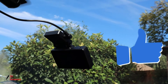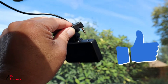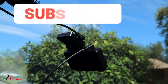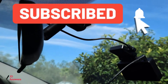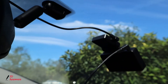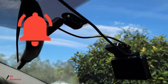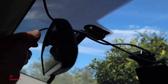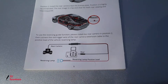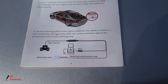Now to install the rear camera wire. We're starting from the front and working our way to the back. Push the camera toward the windshield and it'll move about 30 degrees, then push the rear camera wire in to make a connection. Just like we ran the front wire, we're going to run this wire to the right passenger side making our way to the driver's side, per the recommendation of the manufacturer.